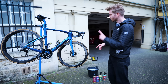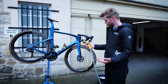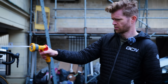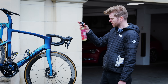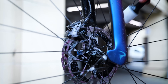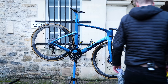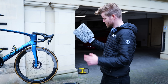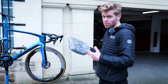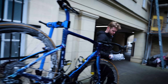Instead, when you clean your bike, I'd recommend the following. First, perform a pre-wash with just a normal, non-high-pressure hose to remove surface dirt so you don't rub it into the frame. Next, use a brake and drivetrain cleaner and spray it on your brakes and drivetrain, then use a brush to agitate it and help loosen the dirt and grease. After that, do a contact wash — the best tool is a nice soft microfiber mitt like this, which is really good for getting into all the nooks and crannies. Don't use harsh brushes, which will scratch the lacquer and mar your paint. Do the contact wash with some bike shampoo in a bucket.